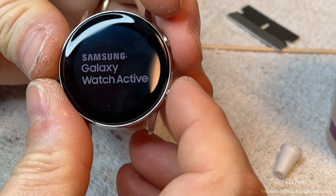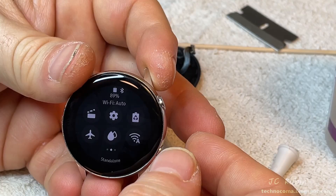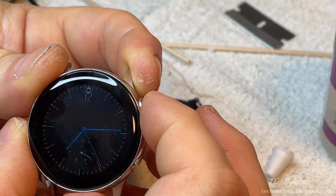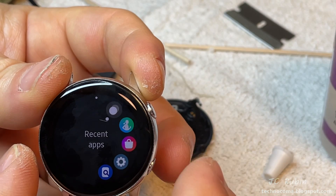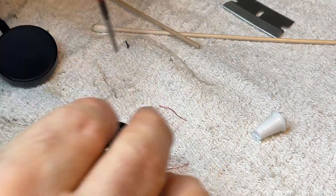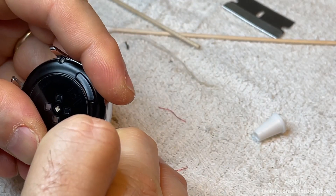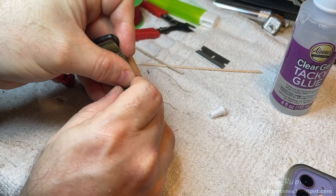Pressing the button, the watch starts to boot up. The back cover isn't on yet — that's just the heart monitor and charger — but I run through quick functionality checks. Going straight to wireless settings, I can see it found my network, which is good. A quick check of button and screen functionality — everything works. I drop the screws back in, tighten down the cover, do a button check again — top button works, bottom button works, screen works, everything works. I'm putting the bands on now; not out of the woods yet, but confident enough.